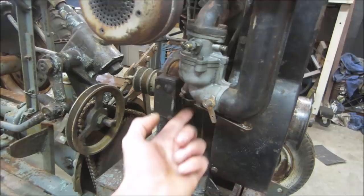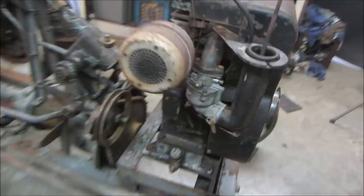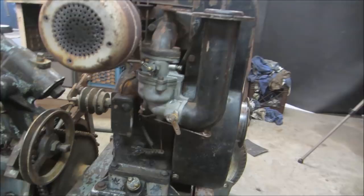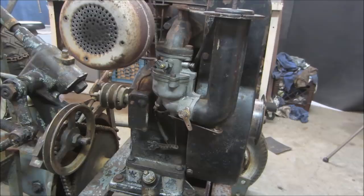Yeah, it's about 10 minutes later. I run the fans, get the smoke to clear out of here. Yeah, she's a tad smoky. That's all right. I don't seem to be leaking any gas anymore. That's good. Fuel's still hooked up to it. Just need a couple love taps on that float, the needle and seat to seat a little better. That's where I was cleaning up with the Q-tip to try to help that. But apparently it needs a little bit of love. We'll see. Keep an eye on it. Worst case, we'll grab a carb kit for that. Probably should get one for the broken gasket anyway.